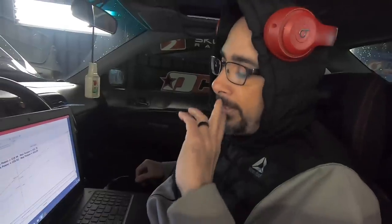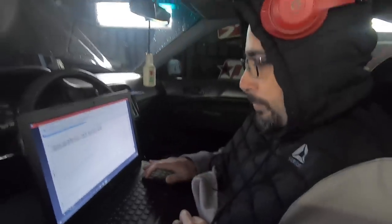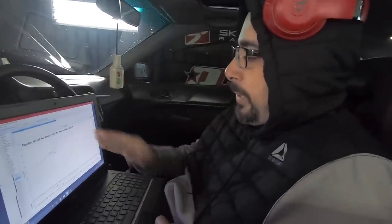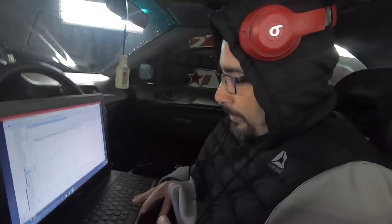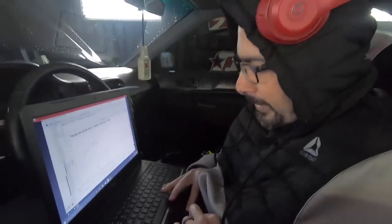That could be another full video. We've done a lot of testing on the road race car, and just inches makes a difference, wherever you want to see the power. You're tuning where you want the power to be mechanically with the exhaust and the intake and things like that. Bolo just wants power, so I'm getting more up here because I know that's what he wants. That's where he's going to be living. So I have to be careful with the timing with this guy and the air fuel. Oh boy. All right, make another pull and see what she can do.